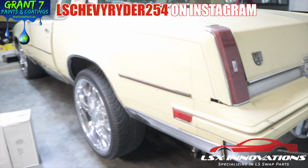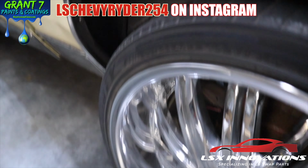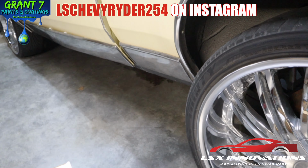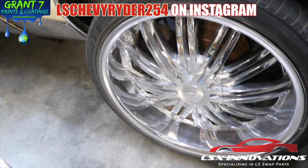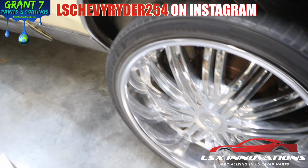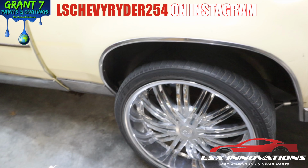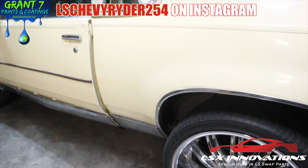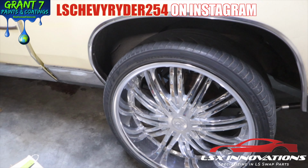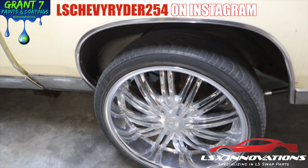Doing a little bit of suspension work on our Cutlass, as y'all seen in past videos. As you can also see here on the tires, we've got a little bit of a rubbing issue, partially due to backspacing from the wheel, but also due to a wide tire. So if we go with a skinnier tire, 240s, 245/40 or 245/30 22s, instead of these 265s, then we should be able to clear. However, we may be able to do something in the meantime.